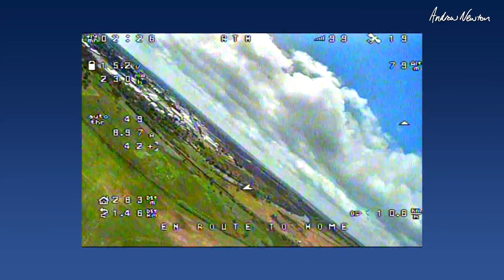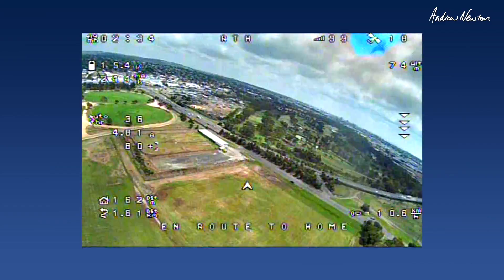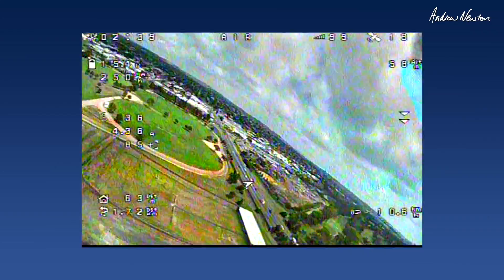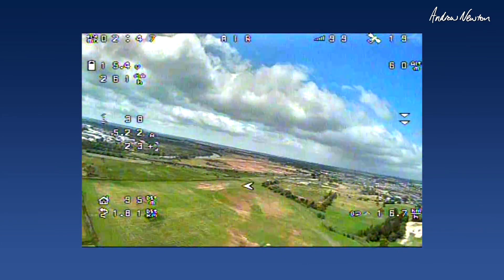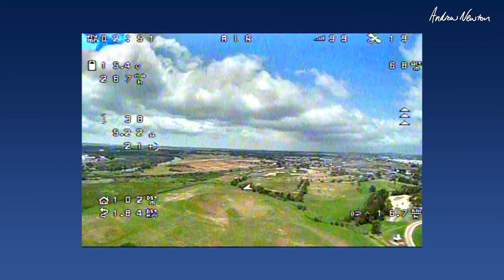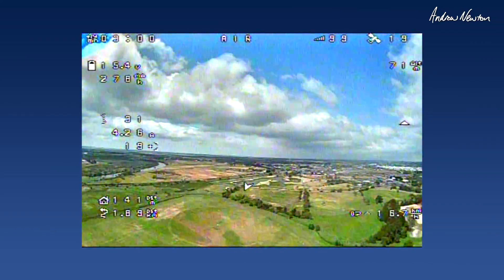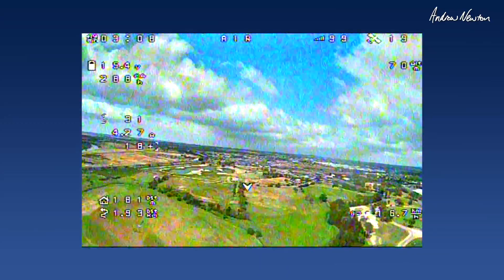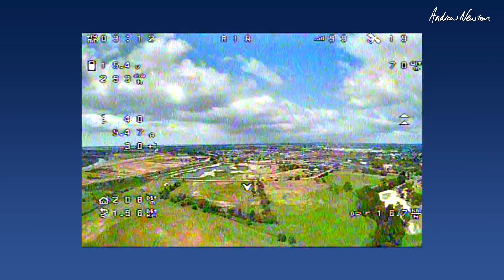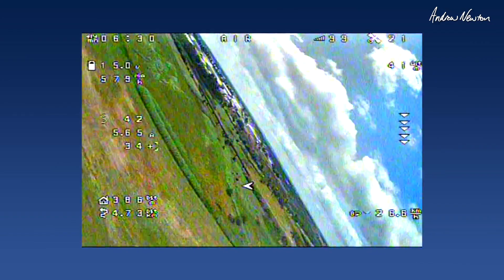Try to return to home. It's all very good. Flying around in acro mode — oh, this is beautiful! Cruising. So we've got five amps on about 20% throttle. Calm down, you can back that right off. Need a bit more for the wind — there's more wind up there than downhill. I'm liking the feel of this motor; it seems to be matched to 4S beautifully. I might try 3S actually, just out of interest, and see what current it needs to fly around on.